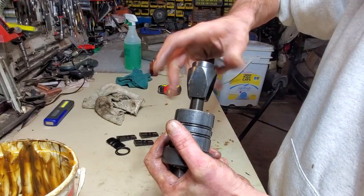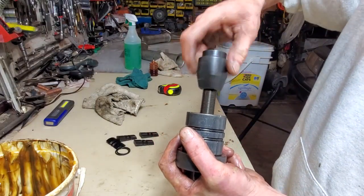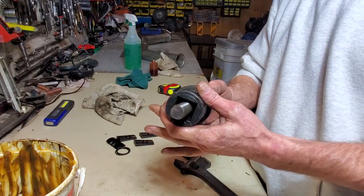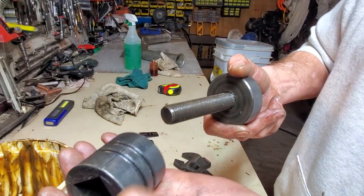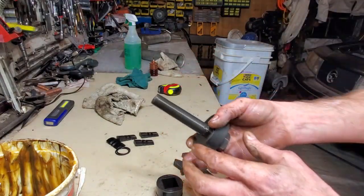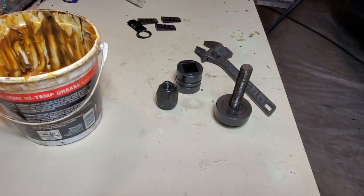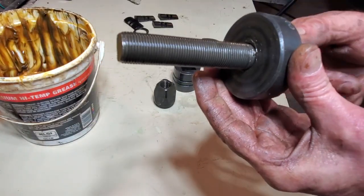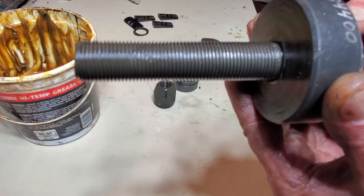I like this a lot. It does the job. I just did it on really what's considered to be high quality exhaust pipe. Again, it was like 0.070, 70 thousandths. And I'll pull my die off. You can check out the condition of the die, and you can check out the threads. Every thread is in really good shape.